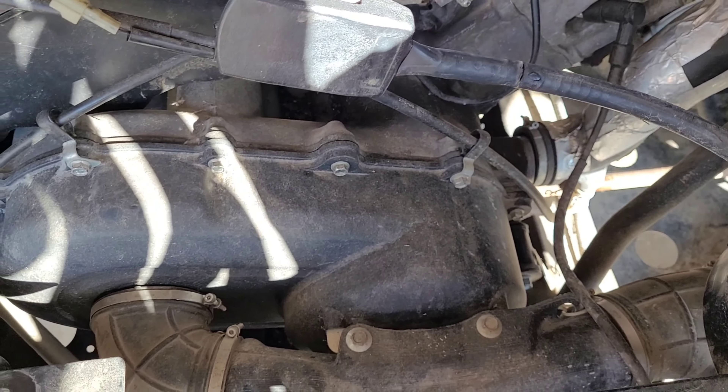You can see the belt is still on — I was hoping it broke; that would've been a cheap, easy hundred-dollar fix. It spins one way and catches the other, so it seems like there's a one-way bearing in there that seems to be working. I'm guessing it is the clutch on the inside, because I've got to rip this off, rip the belt off, and get into the wet clutch to see what we're looking at.